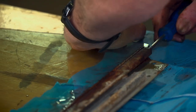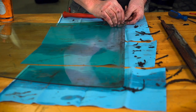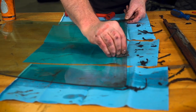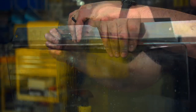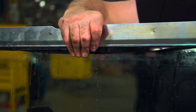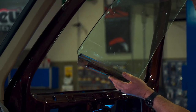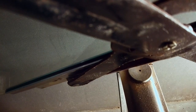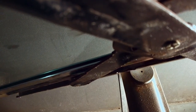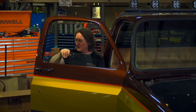We'll carefully work the old glass out of the channel, then install some new LMC frames and filler strips on the original glass. Some soapy water will help this slide on easier. Next, slide the window into the door and into the regulator arms. The bushings need to slide into the greased channels, starting with the front, so it's going to take some maneuvering. For manual windows, the regulator needs to be in a fully down position to line up the slots.